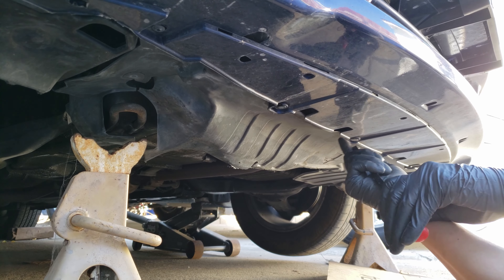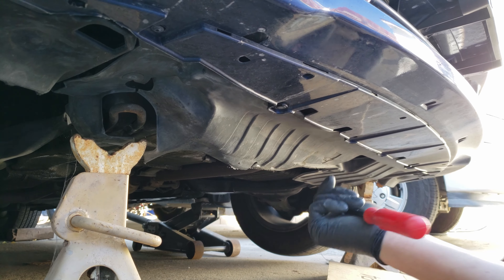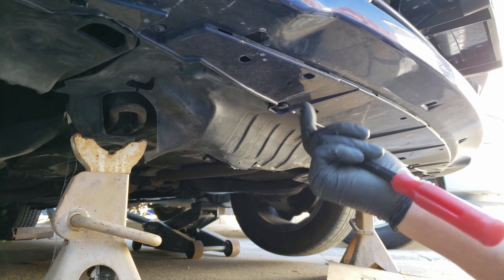It'll have clips to remove here on the bottom as well, and they'll have to be removed in the same manner as the upper ones. Besides the clips, this one has a screw which I used a T20 Torx bit to remove, rotating it counterclockwise.